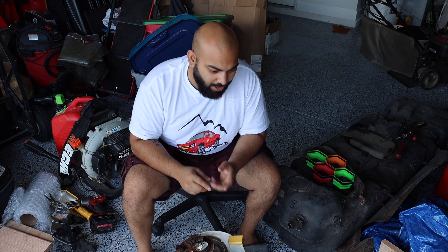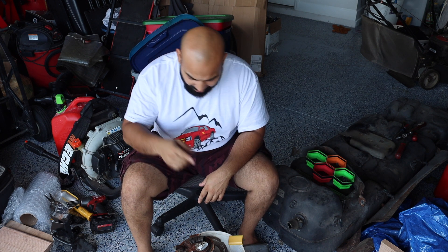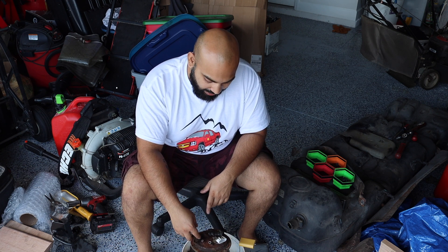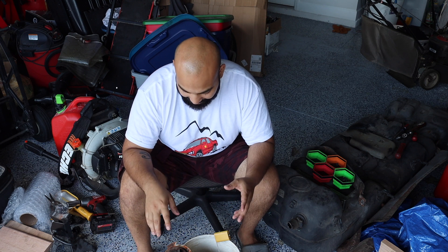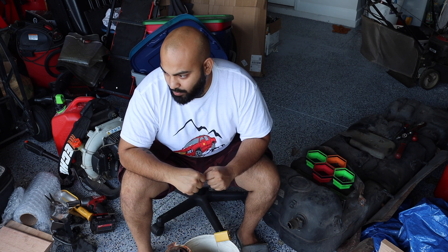Once I finally dropped the straps, I used the floor jack and jack stands to assist in lowering the tank — the jack was the biggest help there. I also used a small pry bar to wedge the tank off the frame at the front, and then the tank dropped down. Once it was down, I had enough clearance to work on the fuel pump. The lines were so rotted — just terrible — so I took a cutter and hacksaw and cut all three of them. I still have to remove the plastic evap lines and then I can put the new pump in.